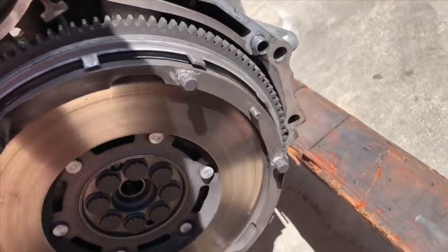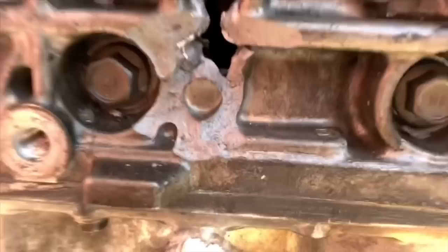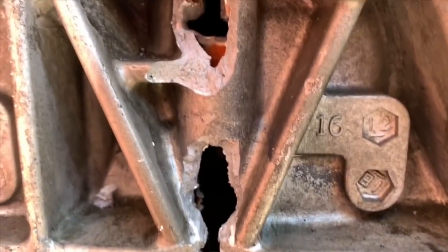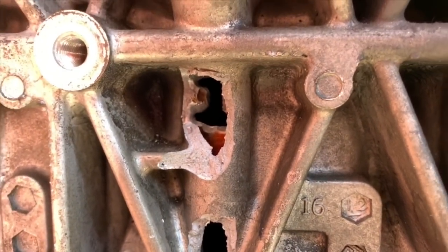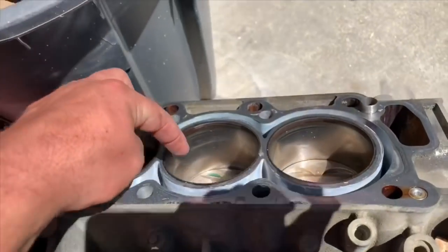Okay. Well, the way to do it is that block and the Type S heads, but you gotta get Acura RL pistons to clear the Type S valves. But. Oh, really? We're just gonna go all J35.